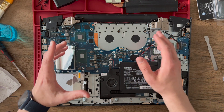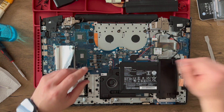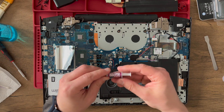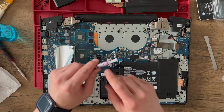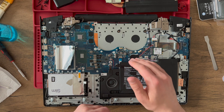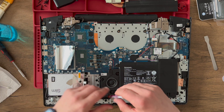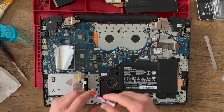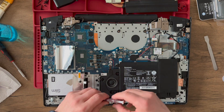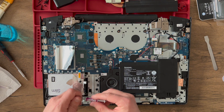With this step complete, we can apply new thermal paste both to the CPU and the GPU and reapply the heatsink. For the purpose of this video I'll be using Cooler Master thermal paste. It's not the best out there, but this is what I currently have at hand. I usually tend to use Arctic MX4 or MX5, but there was none at a PC shop near me. We'll be going with the Cooler Master and if there are any issues we can replace it in a month or two — it's not going to cause any heating problems for the next few months.